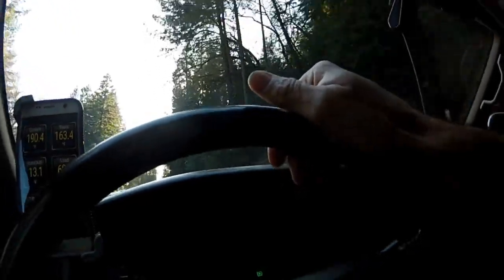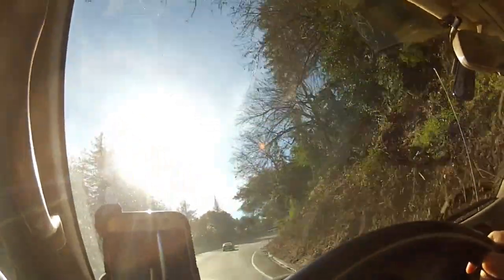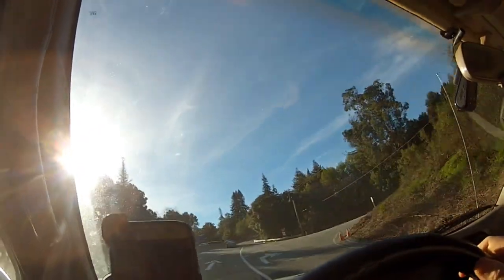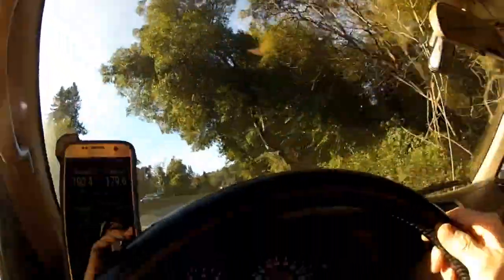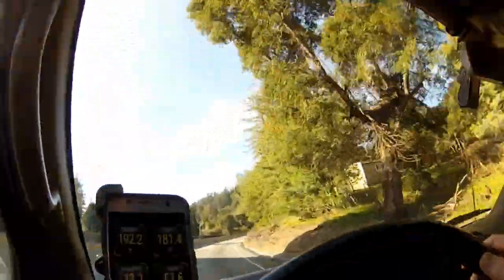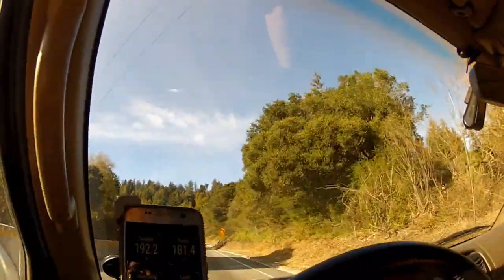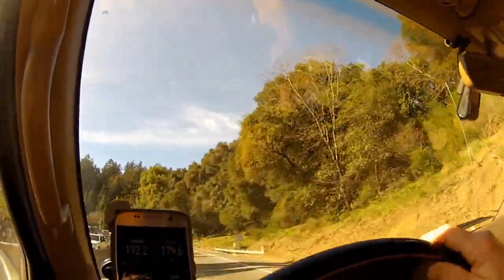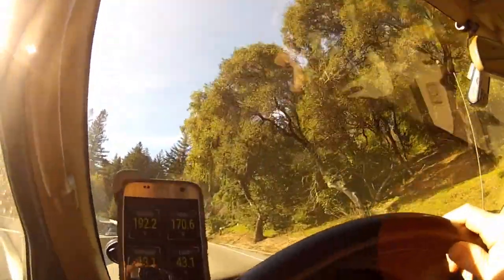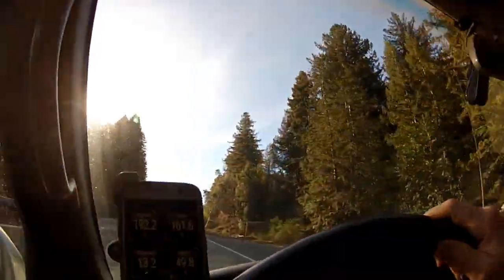It's downshifting again — I'm giving a little more throttle, the RPMs are up. Transmission temperature is climbing, watch it climb. It's sticking in that third gear, it's downshifted from the effort — 180 degrees. Now I'm going to switch overdrive off. Watch the temperatures drop. Look how much it dropped when I turned the overdrive off — it went from 180 down to 160.